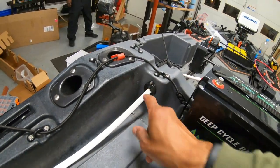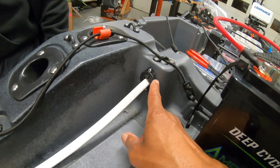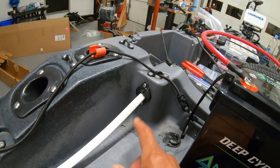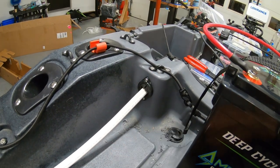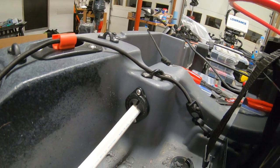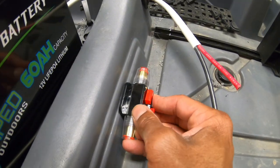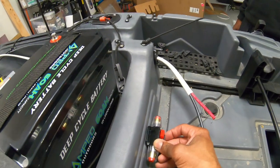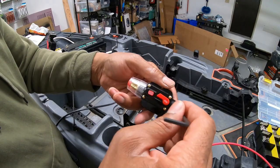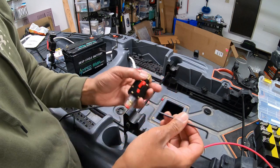The wire is pushed through the one-inch hole with the heavy-duty grommets on both sides — these will not take on water or wear out over time. The screws that came with the grommet had flat ends and were useless for this application, so we used our own stainless steel three-quarter inch number eight screws from Lowe's — not self-tapping, just regular screws, since you don't want to self-tap plastic and risk drilling out the hole. We're installing the 60 amp breaker here, adding a small spacer to compensate for a divot where the surface isn't flush.